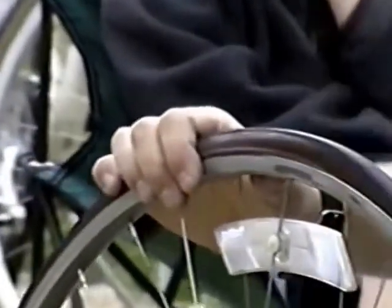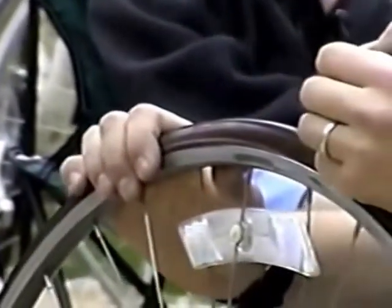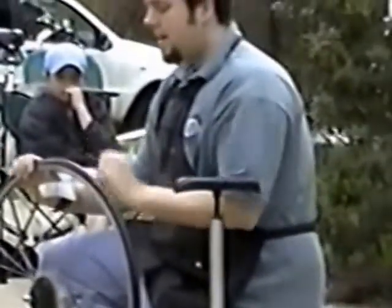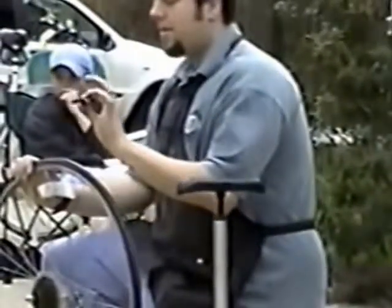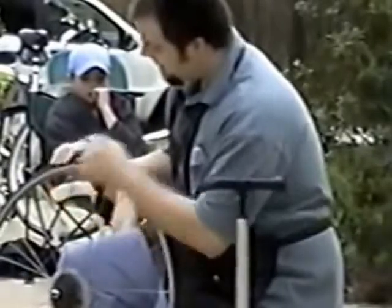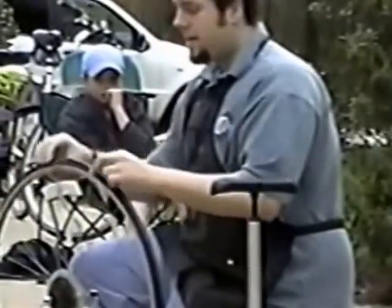You will break your tire lever before you break the rim of the tire, especially the plastic ones. You can get metal tire levers that also have sharp edges, which I don't like as much. They can pop the tube also. But the plastic ones are strong enough to do the job, but weak enough where if you really get in trouble, they'll break. So, now the tire kind of just popped over onto the bead.